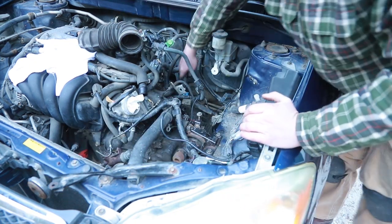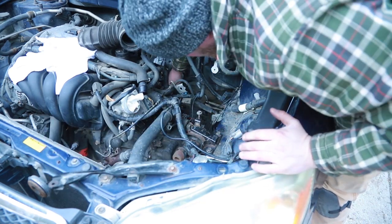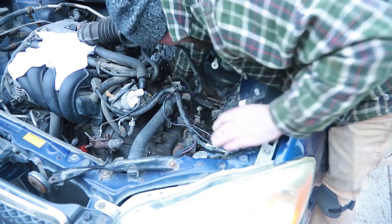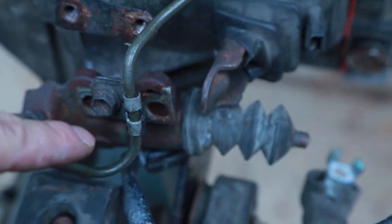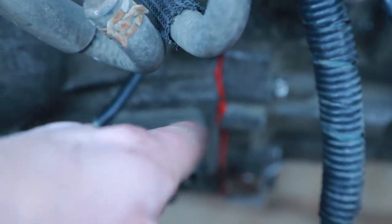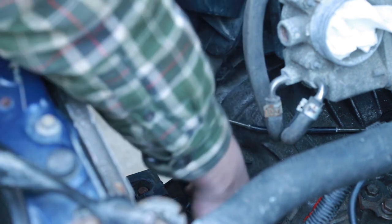Three, tight. Okay, there's an electrical connector that you saw there from that other one, little guy right here. I think I'm done down in that area, so I can probably go ahead and plug that one in. Click, click, done. All right, next, two bolts that hold this on. When you press your clutch pedal down, this goes in and out and pushes the clutch fork inside there, and that's where magic happens.